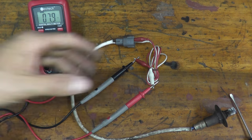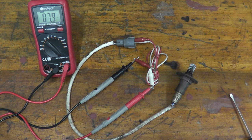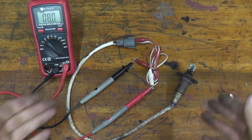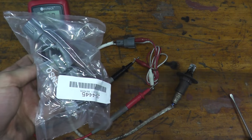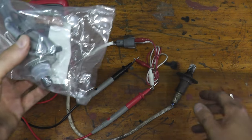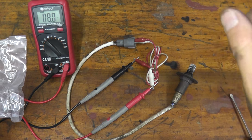Now, in my situation, this sensor is perfectly fine, but this vehicle really needs a catalytic converter. And when you replace a catalytic converter, it's always a good idea to replace the oxygen and the air fuel sensor. So I have the new sensors here. So the next video I'll be doing is replacing this catalytic converter. But that being said, very easy to test. I'll show you the other option using a scan tool.